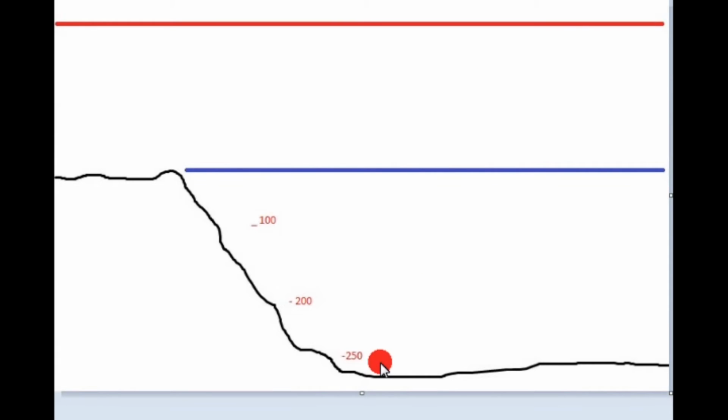So the first thing obviously you've got to do is reset your home point, so the quad knows that you've moved from there. Now you can do this through the DJI Go app, or you can activate the dynamic home point system, whichever way you want to do it. You've got to say that is now my home point, providing that that's where you want the quad to come back to in the case of an emergency. So the quad's flying around, it goes, right, I need to return to home, low battery or whatever. So the first thing I'll do is elevate to 100 feet, whatever you've got it set to. Come across to it's above you, then it'll start to descend.